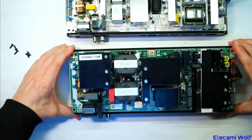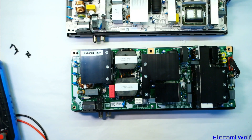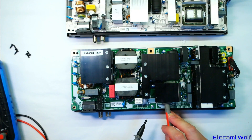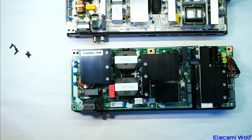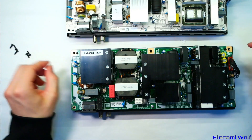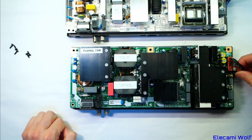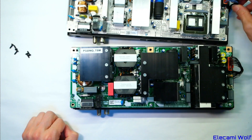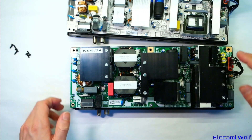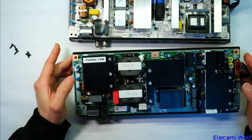There are capacitors under there. I just want to check those before we get in there, just in case there's some remnant charge, although it's been unplugged for a fair while. Let's see if we can measure that without shorting them out — 1.2 volts, so they safely discharge themselves if left alone. So it turns out the power supply in this one is quite a bit different. They don't even use ribbons for this cable anymore — it's individual wires. This is the new one; that's older. Maybe the old design was not so good, so they got rid of it. There are four bridge rectifiers.